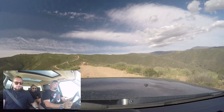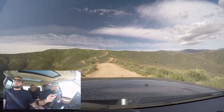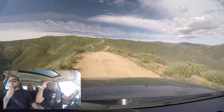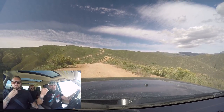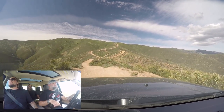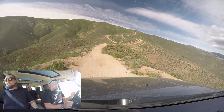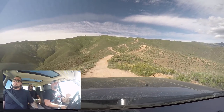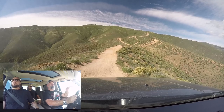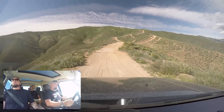Can you just put it in low versus high, or do you have to go to a driving mode? That's a good point, Tim. So independently adjustable of each other are low and high ride height, low and high transfer case setting, and then the driving modes for computer traction control — and you can set them all independently. There's also hill descent mode. When we started, we were in high, normal, non-lock diff, then we went into lock diff, then rock crawling, but all independently. I don't even need to use my brakes — with low range I can just lift off the gas and it brakes for me.